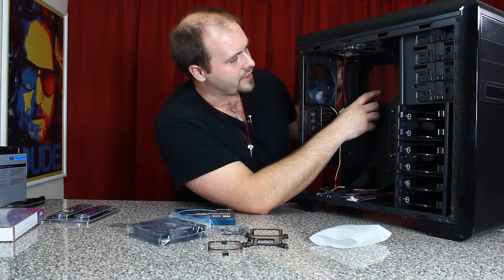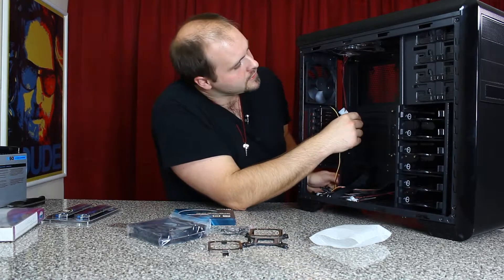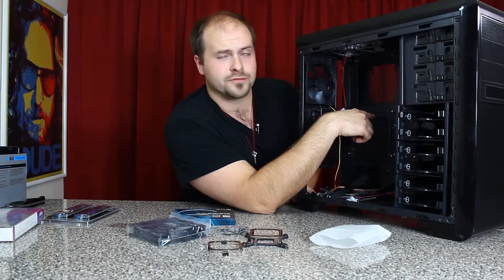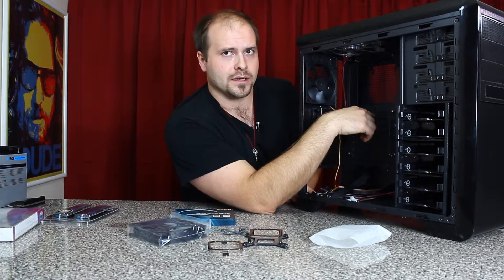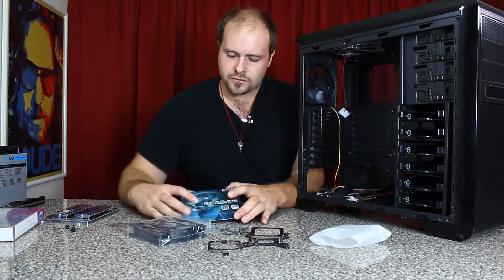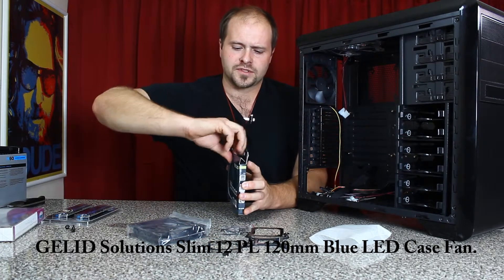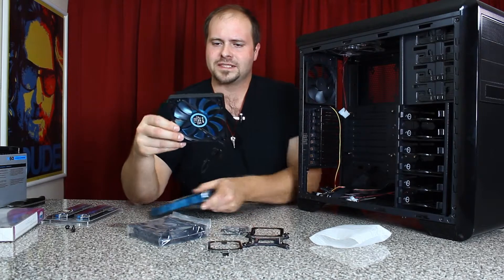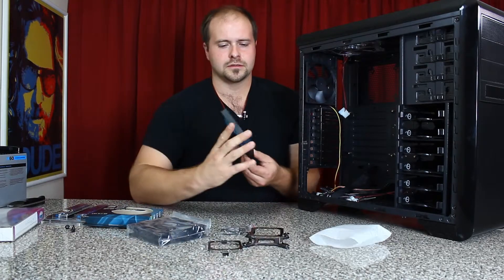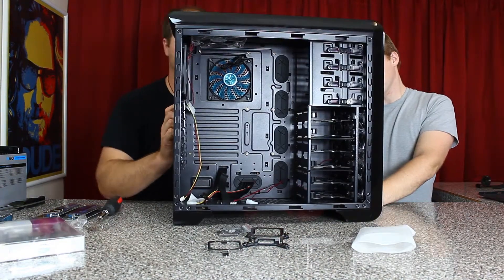This slot may not take a standard 120 millimeter fan — it's for a 120 millimeter or an 80 millimeter fan, but if you put in a regular size 120 millimeter with the standoff for the motherboard you have just barely enough room — it would actually be touching the motherboard, and you're not going to want that. Once you have the bracket for the cooling on there it won't fit anyhow. So we went with the Gelid Solutions Slim 12 fan, which is about half the depth of a standard 120 millimeter fan, and we're going to mount this on the back.